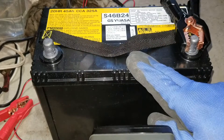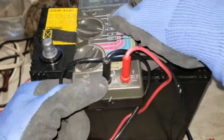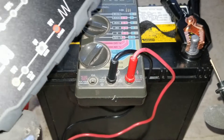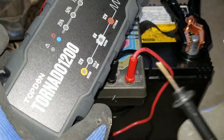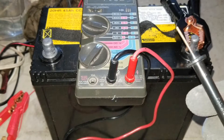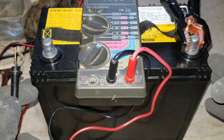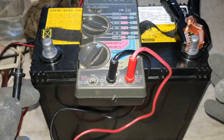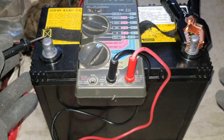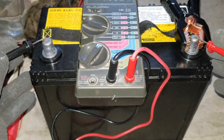I'm going to test this 2012 Prius plug-in battery and try to revive it. I put it on the Tornado 1200 charger set to AGM mode — make sure you have the right charger setting. Unfortunately this one would not take the charge, so I'll use my old-school 10-amp 12-volt charger to bring the voltage up to at least 10 or 11 volts before the smart charger can take over. It's now showing 13.12 volts, which is pretty good.